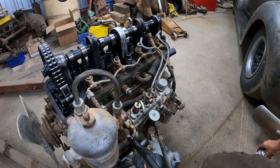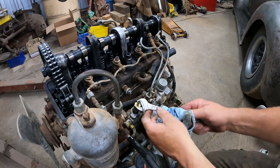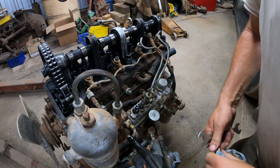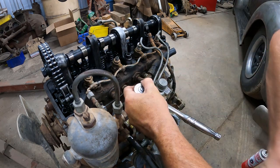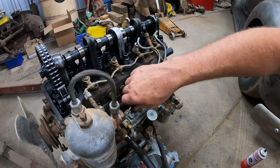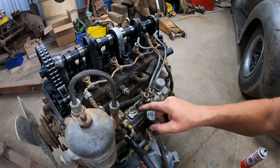So when you're done with it, set the timing, tighten the 3 screws on the back, on the front. Sometimes there's a bracket on the back, depending where the engine sits in. You remove the overflow pipe. Take out the delivery valve. So again, there is a copper ring on top of the valve.